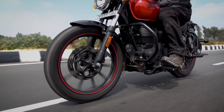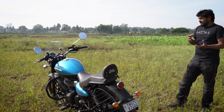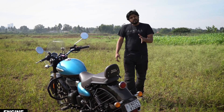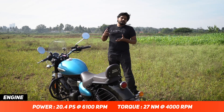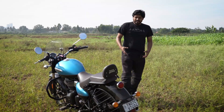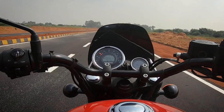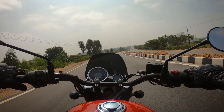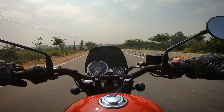There are some vibes on the footpegs but these are not the crazy ones that make your feet numb — it just feels like the vehicle is doing something. Coming to the actual power available: we have 27 Nm coming at around 4,000 rpm. Personally I wish a little bit more of that torque was available at slightly lower rpm — it would have made the ride more fun — but there's nothing wrong with it. It gets going very easily and the torque really pulls you from 0 to 80 quite fast. It will do 0 to 100 quickly and then struggles a bit to reach 120.